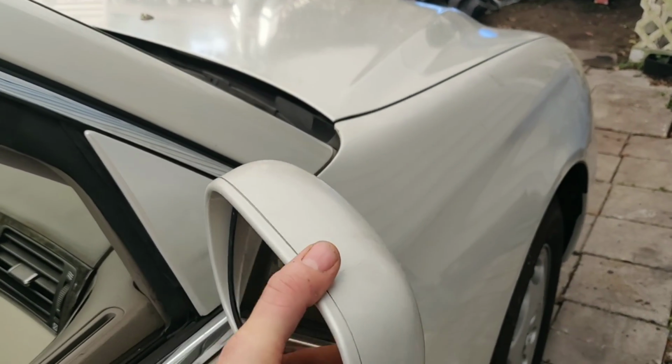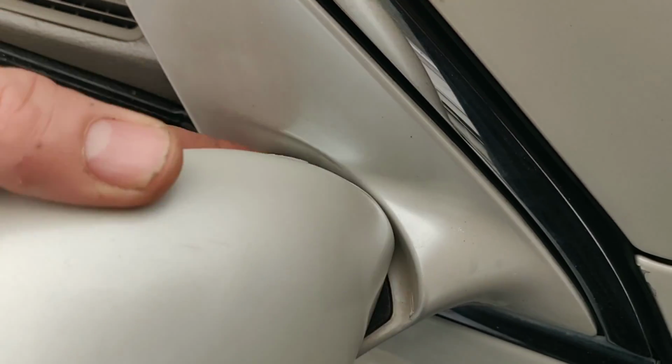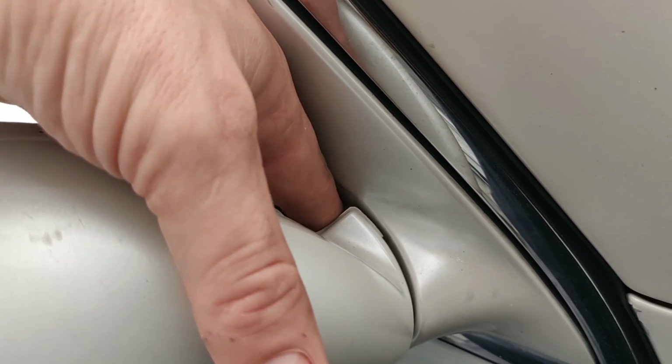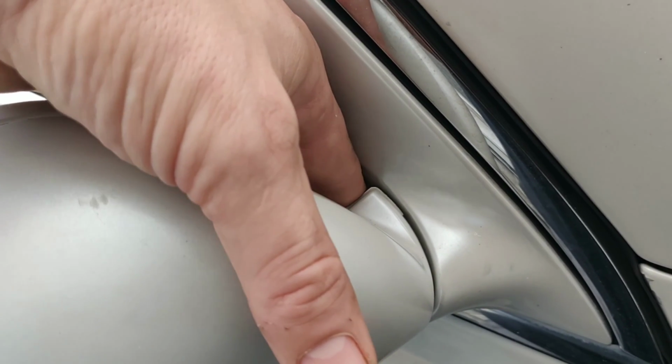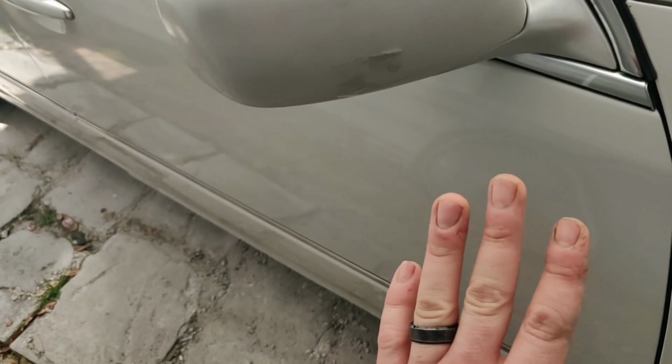And what I saw every time I was watching this go in and out is, if you look down in here, it lines right up to that when it's fully open, but it just keeps going. And so I realized I could put a stopper here so that when it shuts, it's going to stop on that, and the motor's going to stop, hopefully. So that's what we're going to test out too, make sure the motor doesn't just keep going and we wear out our motor. But from what I know, it's going to basically stop the motor because there's probably an internal gear that broke, is my complete guess on this.